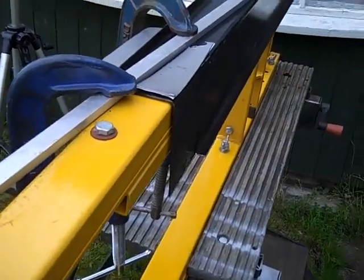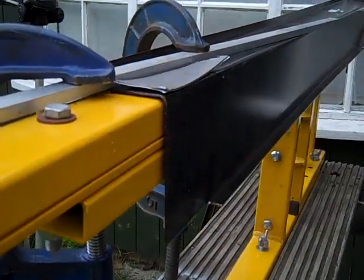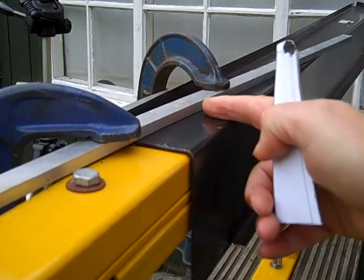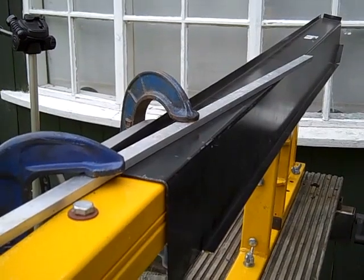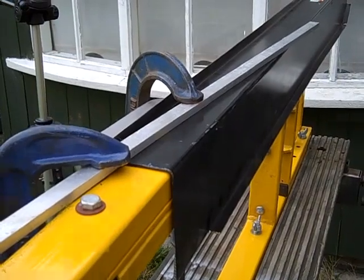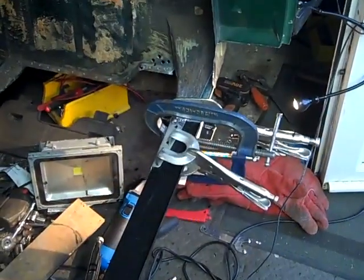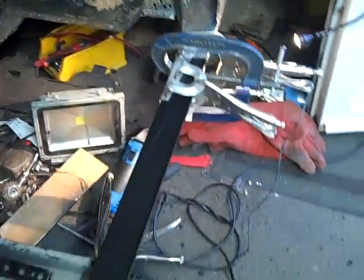So we've now got the sill clamped in place. And if you look carefully you can see the metal underneath lifting it up, where this gap is caused by this piece of metal now missing, and now we can hammer this section similar to this shape and it will sink down and we should form the top of the sill. So hopefully you can see now that's pushed down and we've got a position now for the strengthener to fit into. So although it's a bit tricky to see, we've now got the sill positioned in place pretty much where we think it needs to be.